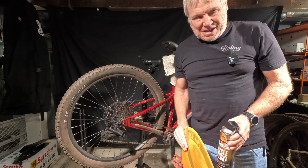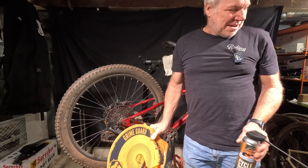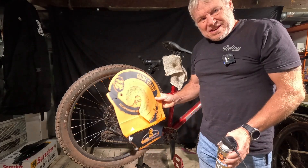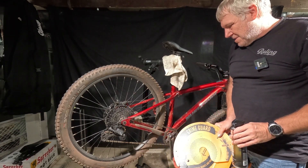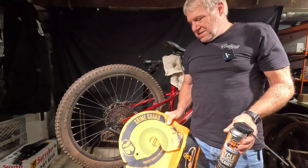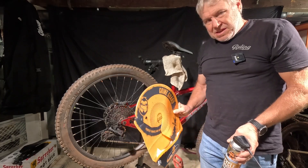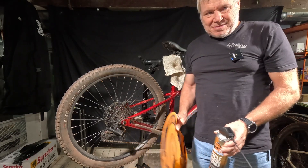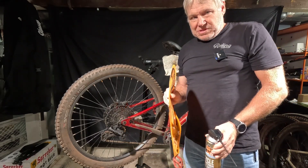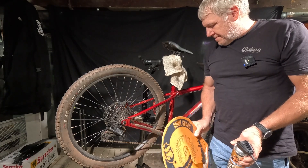If you've been watching my channel, you'll notice my stuff gets dirty quite often and I'm not very vigilant about cleaning it. I ride in Cuyuna a lot, which tends to have that kind of red iron ore dust that gets all over everything. You can still see it on this bike here because I only cleaned this area. It's pretty good to be able to clean the drivetrain, and now all I have to do is lube the chain and I'm good to go. Not sure on this bike I'm going to use wet lube — this is a mountain bike that I take on dirt, so I'll probably put dry lube on here. The wet lube is good for winter, commuting bikes in winter, fat biking, things like that. It's definitely nicer to use a wet lube in those conditions.